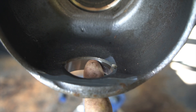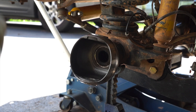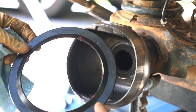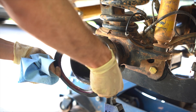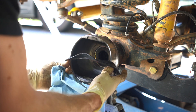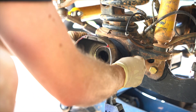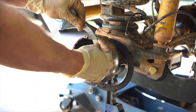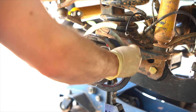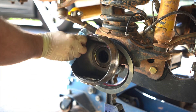Take a closer look and make sure the seam between our race and our knuckle is flush with no gap left on the top, bottom, and all the way around. Before we get our knuckle on, we've got to get our Trail Gear seals on. One side of the seal has four dots — those dots are going to face the differential. Best way to get this thing on is to start like this, then start flipping the seal to follow the contour. Then go ahead and rest it on the axle. Then get our metal ring on — pull it apart until you can get it around, then bend it back the opposite direction to flatten it back out. Those can rest there until we're ready to get our other plates on.